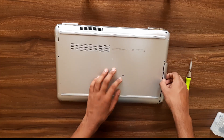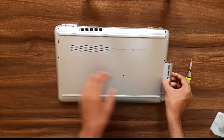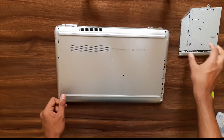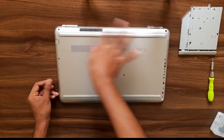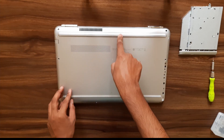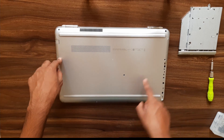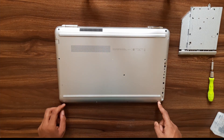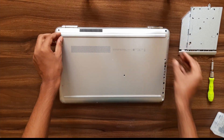I've taken the screw out, now we just take the optical drive out first and keep it aside. Now we need to take all the other screws — there are two screws here, one under this, one screw here, one screw here, and four more screws at the side.